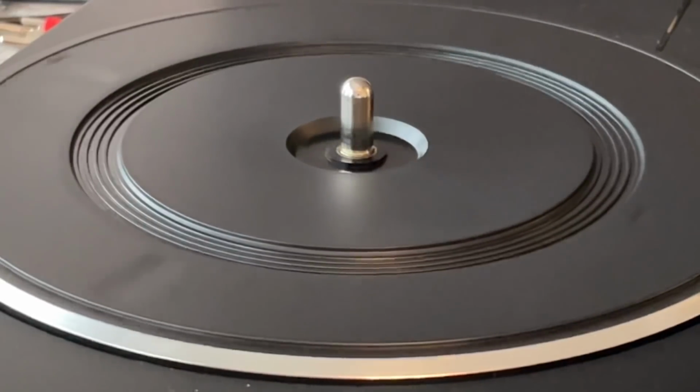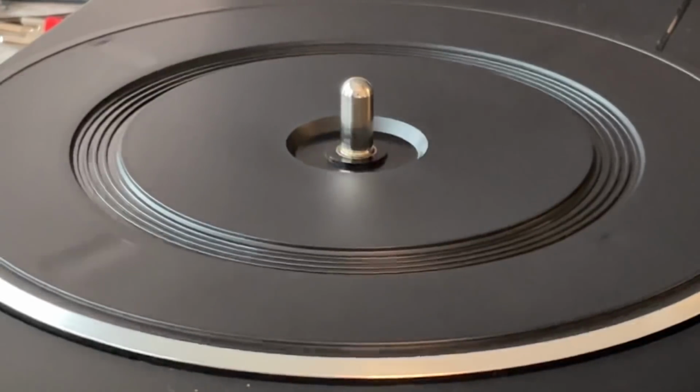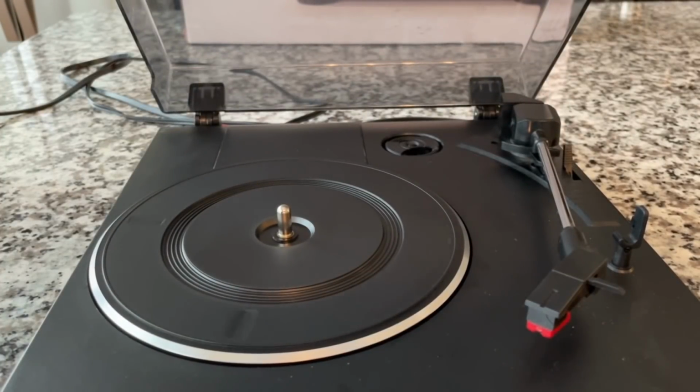How does a direct drive turntable work? Essentially, the motor, instead of being connected to the platter via a belt, is directly connected. How is it connected exactly? We're going to see when we tear down the direct drive unit here in a little bit. While audiophiles like belt drive turntables, oftentimes DJs prefer direct drives, and even some people that just listen to music like a direct drive turntable as well. But they represent a very small portion of record players sold today. One of the concerns of a direct drive turntable is that motor noise being transmitted through and those speed variations being transmitted through, like we talked about before. Although modern manufacturing techniques and components have largely eliminated the issues that were experienced in years past.